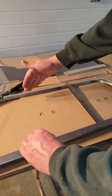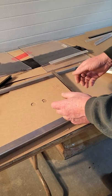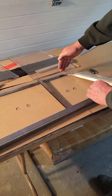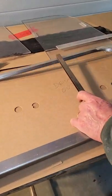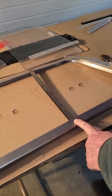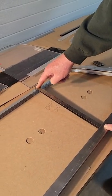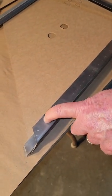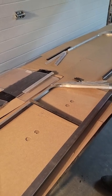I have seen setups on a Cobra where the top and bottom channels aren't necessarily parallel, so when you slide the window forward it can fall out of the frame or doesn't want to slide back. It's important when setting this up in the car that the top and bottom channels are parallel to each other. These pieces get upholstered as assemblies and then pop-riveted back together when all done — we pop-rivet this channel to that channel, this channel to this one, and right through the front window and through the bottom channel.